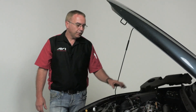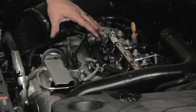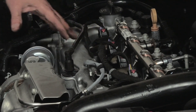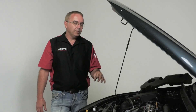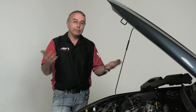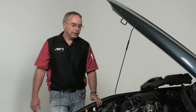You can see the fuel injectors go way down inside the center of the head area. There are a couple of wiring harnesses in the general vicinity. If I were doing a valve cover gasket or anything requiring disassembly, I'd want to make sure those wires are back in their wire holding looms, because if a wire is laying against the actual fuel injector, it's going to resonate and magnify the sound to where it's very audible inside the passenger compartment, even with insulators in place.